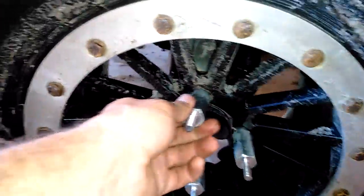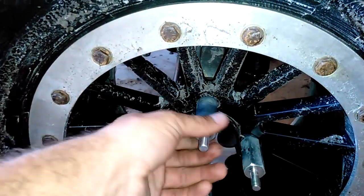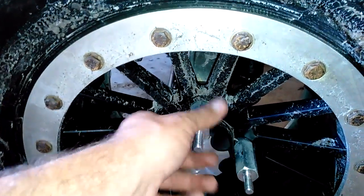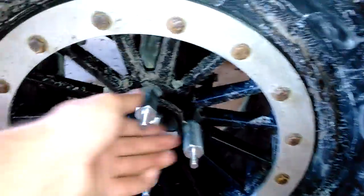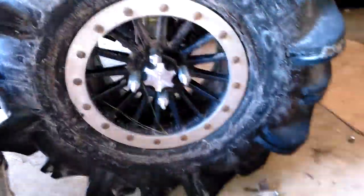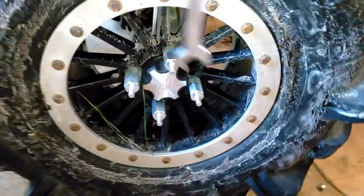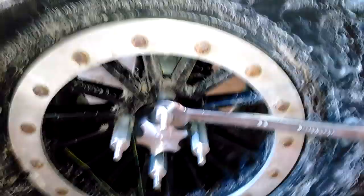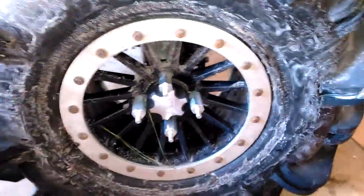So you put your cone washer on there, and then you thread on your wheel spacers on top of that. So this is acting like your lug nuts for your inside wheel, but it's giving you a nice surface. So that's a 22 millimeter, so put that on there. You don't want to go crazy torquing it down because of the little cone spacer, you don't have a whole lot of thread on a Rubicon. The older Hondas that had longer studs, it's a pretty long wrench, so I put them on to about 45, 50 foot-pounds. Okay, so that's on there pretty good.